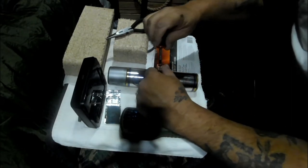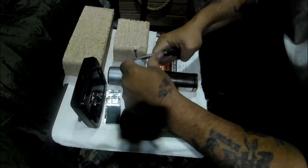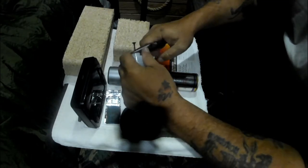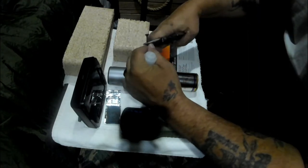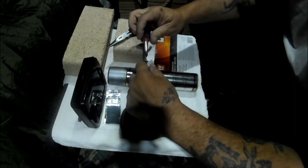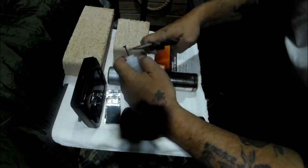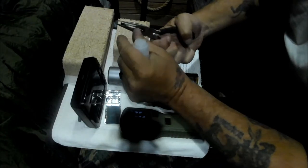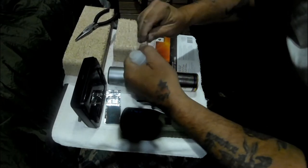Let me get a better bite with a screwdriver. Some people do this with a claw hammer on the screw to pull the valve out — sometimes the valve is very obstinate, like this one is. We'll get it out here in a second — there it is. And that's all that is: a one-way check valve.